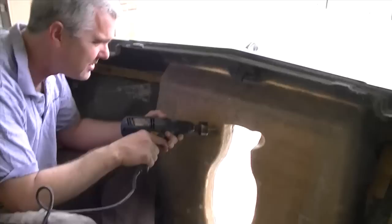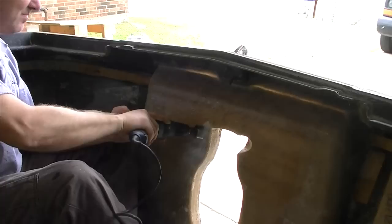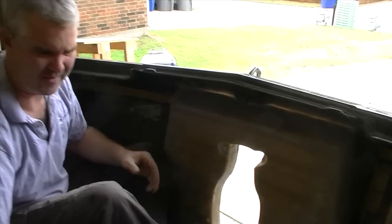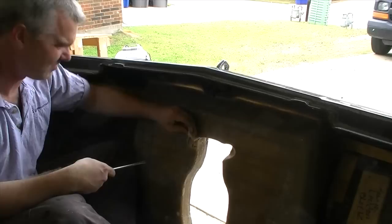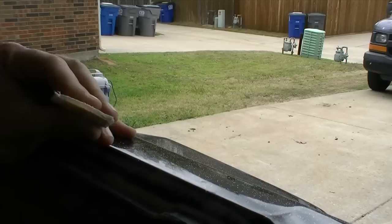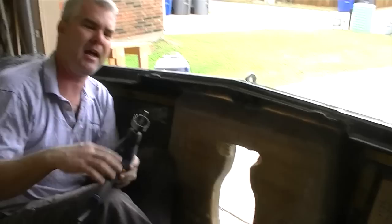So what I'm going to do is take this and put it about like that. You have to pull out and then start chipping away at the layers, because your hole saw will not be long enough to go all the way through in one fell swoop. You want to see what 2 layers of 1708 looks like? Right there. See, there's the wood. There's 2 layers of 1708. Pretty good build, if you ask me. And I actually retrofitted a longer bit on here, which allows me to drill a little bit deeper at an angle.